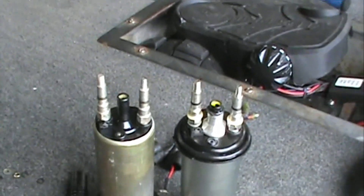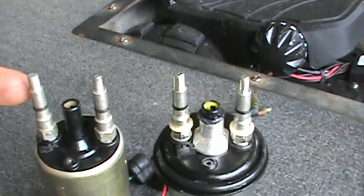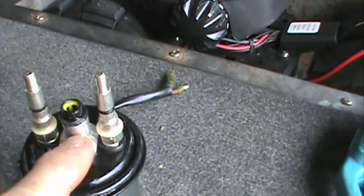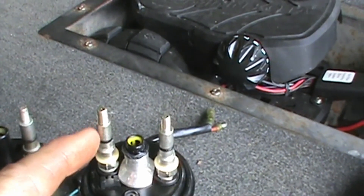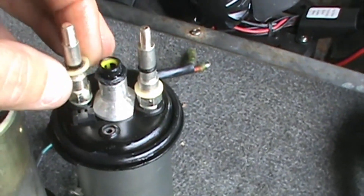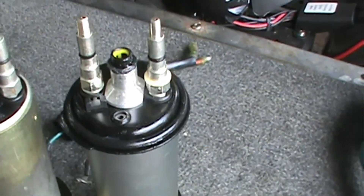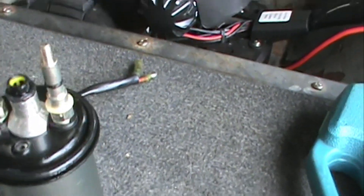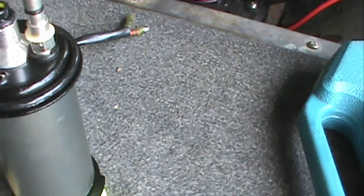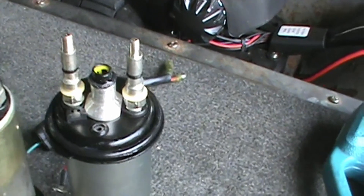When you're installing your pump, the o-rings are already included with the new pump — they're already on it. Now this nylon piece here is on the old pump, so it may not come with the new pump. It may be stuck where the bolts go through for your terminals. These nylon washers may be inside your VST upper housing, so you want to get those out.